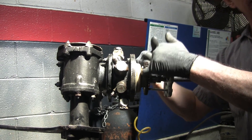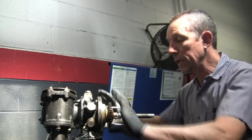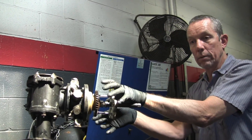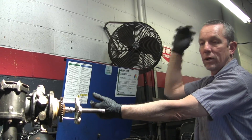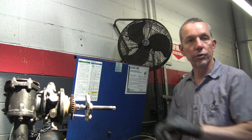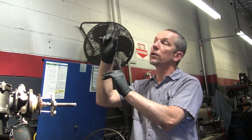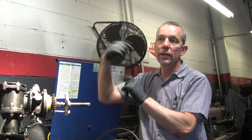When this seal leaks up here you don't know for a while. There's a transfer gear box up here that has O-rings and is sealed, and then your steering shaft comes up with a rubber boot around it. So what it does is just fill up, then you get this leak way back behind the seat and you wonder where it's coming from. If you look from underneath you'll see the steering housing coming down and there's a little weep hole — it'll be coming out of there.